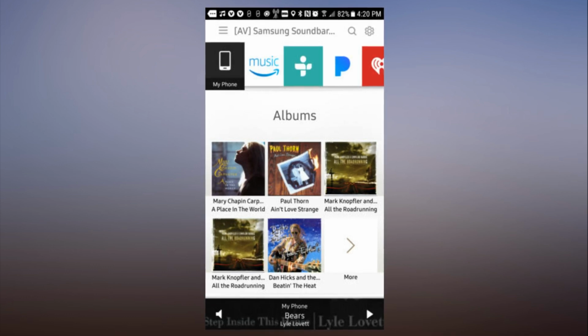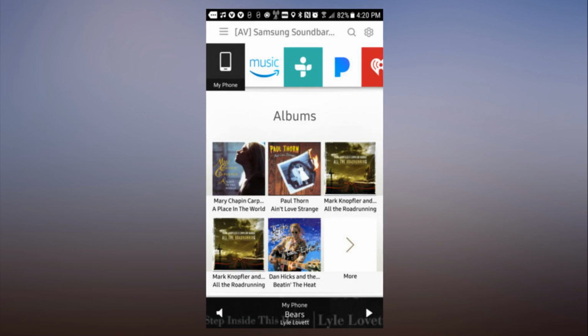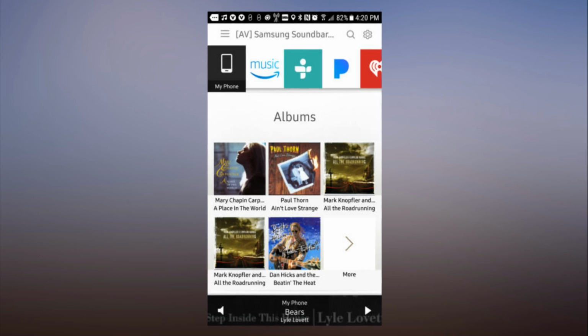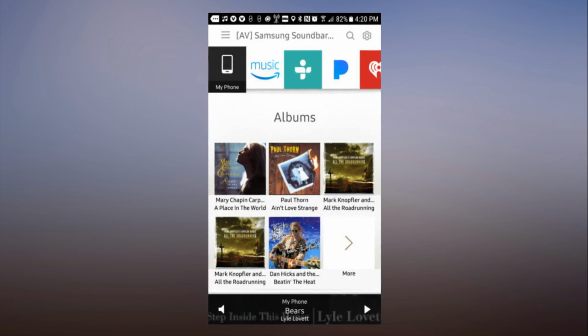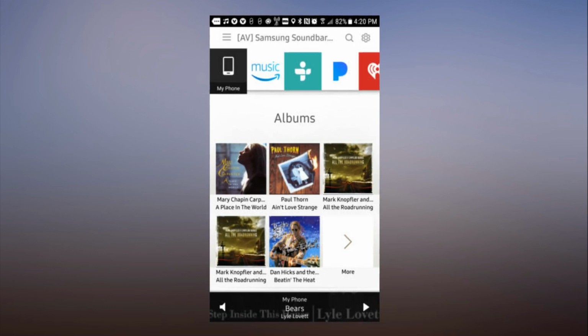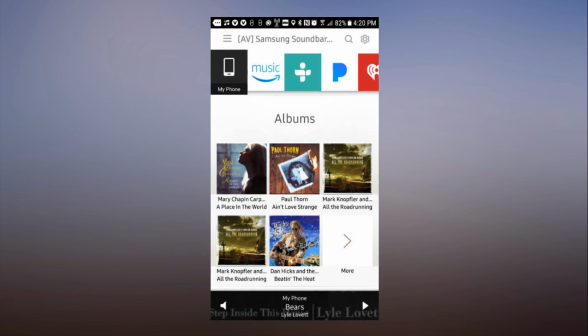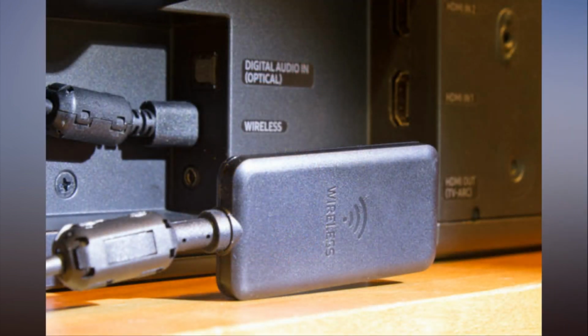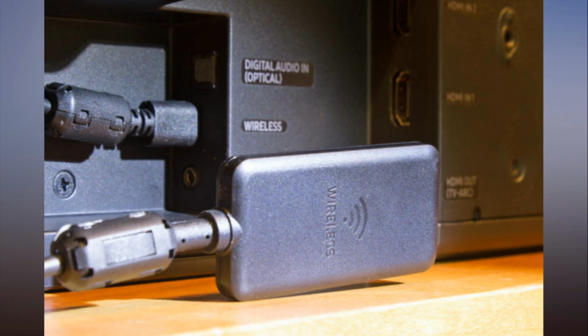Samsung's HW-MS750 Sound Plus soundbar has 2 HDMI inputs and 1 output with ARC support. The MS750 is a 5-channel soundbar that supports Dolby Digital and DTS surround sound codecs, but you'll need the aforementioned subwoofer and Samsung's $180 SWA-9000S/Z wireless surround speakers, available at Amazon, to get true 5.1-channel surround sound. There is no support, however, for the high-resolution codecs Dolby TrueHD or DTS-HD Master Audio that you'll find on Blu-ray and Blu-ray Ultra HD discs.